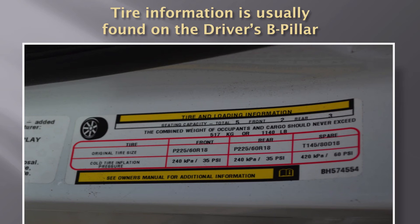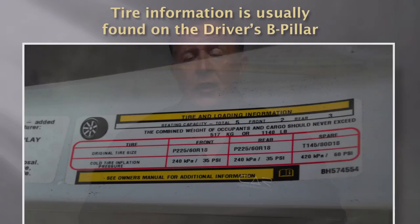Let's talk about tires further. It's important that you use the tire manufactured for that particular police car. If you open your driver's door and look on the B pillar or on the inside of the driver's door, you'll find a white and red sticker. It will give you the proper size and type of tire for your particular vehicle, and also the proper inflation value. Don't use the tire inflation number on the tire itself — use the tire inflation number on the B pillar. It adds to stability.